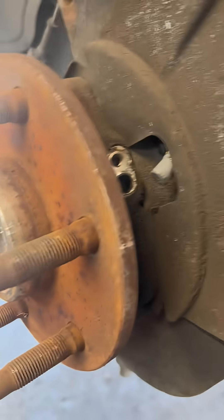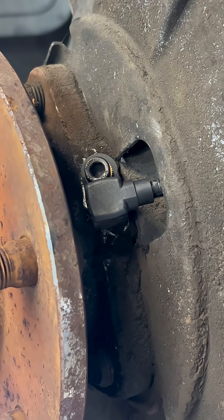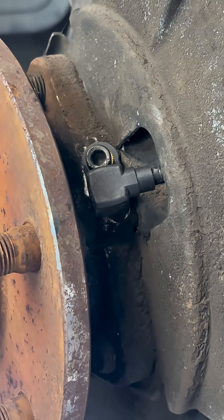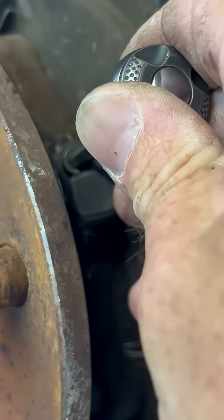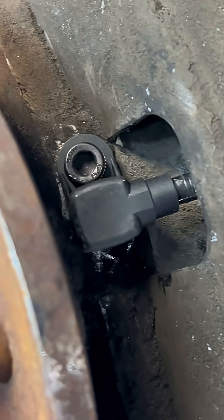Route the wire through the back panel and then insert the sensor. You definitely don't want to crank too hard — use a quarter-inch ratchet, hand tight. That's it, it's installed. These sensors are very sensitive, so use only a quarter-inch ratchet hand tight or you will break it easily.